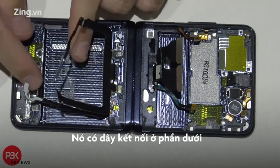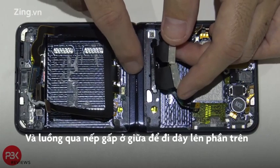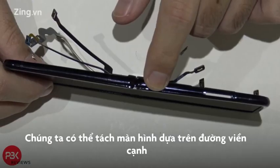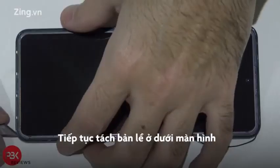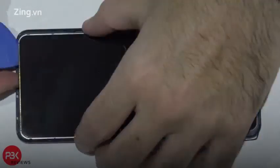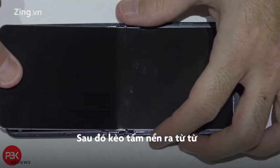Your screen cable is right here, and you have these cables over here which are run through the flip hinge area. There's a small thin border right there — it's attached to the frame over here, so we're going to have to pry that off. Use something thin to get underneath the metal plate of the screen. Once you pry the screen off a little bit so all the adhesive is loose, you're going to have to gently slide the screen down.